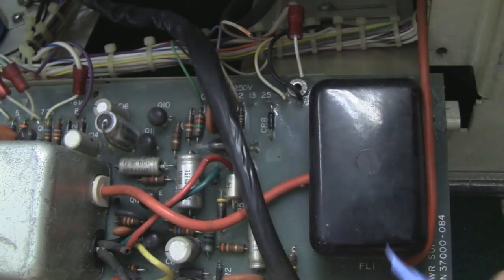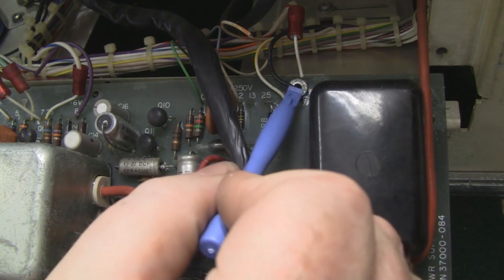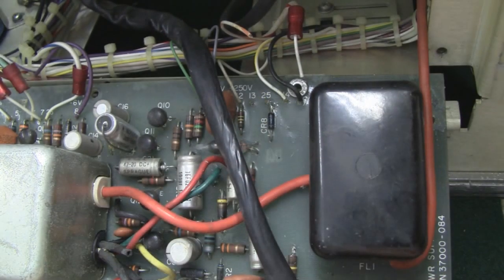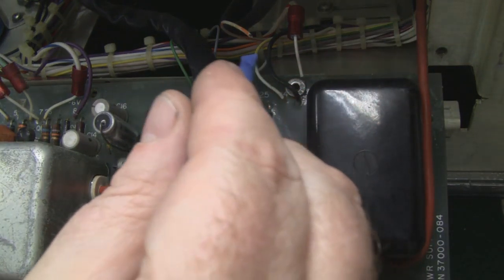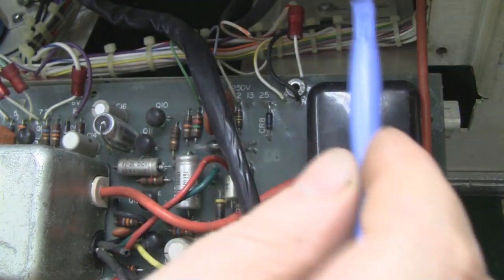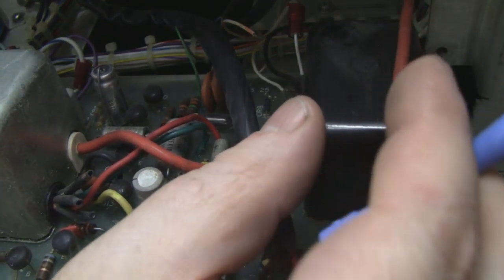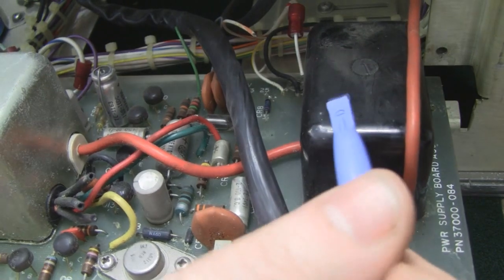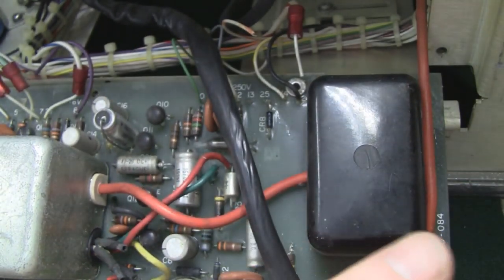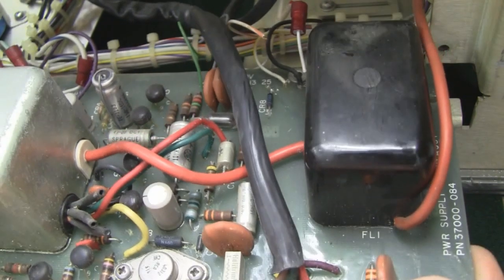I've opened up the high voltage panel first because of the evidence of tampering, and straight away I found two wires that have been snapped off from the main board. It could be that because this is on a hinged system, somebody was heavy-handed and they got caught up somewhere and ripped them away — that's what it looks like, not burned off. Also, the high voltage cable from the flyback transformer does get caught on that side and is showing signs of stress, which could also be a problem.